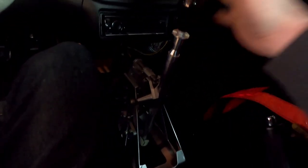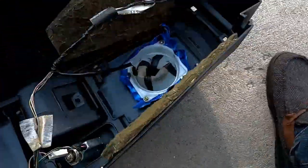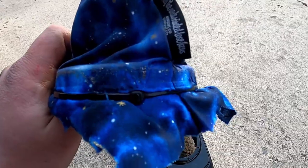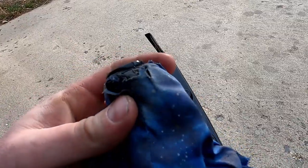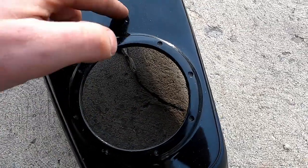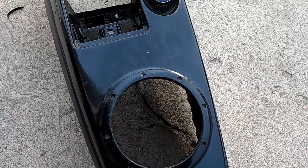This thing feels great, but I need to trim the center console. In order to do that, we have to first remove the boot. To get the boot off I'm going to flip it — there are four little screws on the inside. With the boot out, this is just something I got from InFocus — a little boot cover that goes over the OEM boot. You can tell it's seen better days. Now we're going to pull this in and try to put it on, see where I need to cut. I'm going to make some marks with a Sharpie and make my incisions.